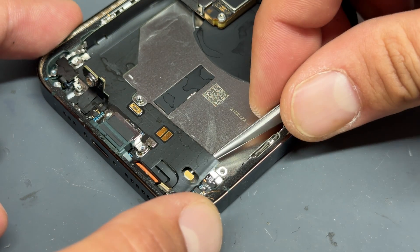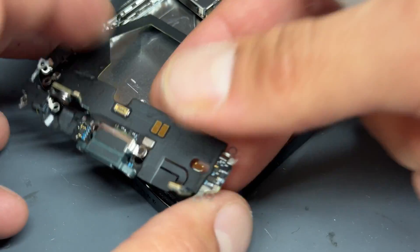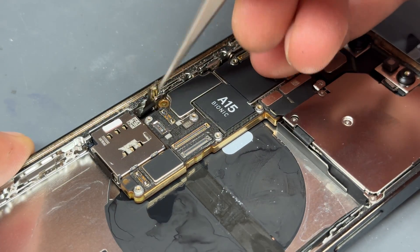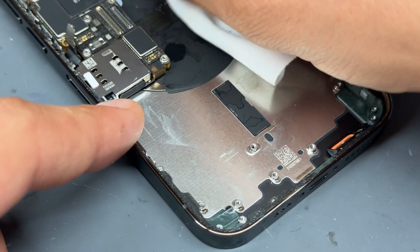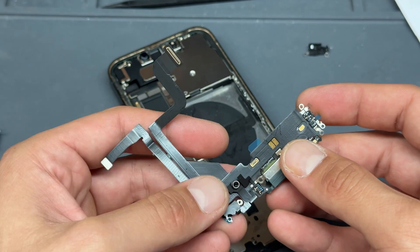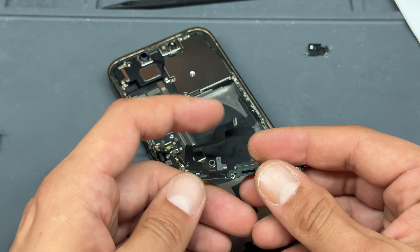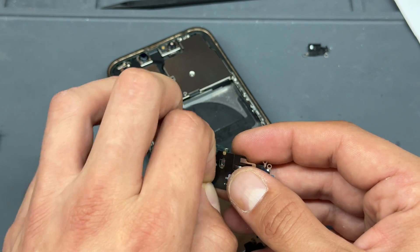Now that the battery is out, get underneath the charging port and lift it up until it comes out. For the top end it's just pulled out — make sure it's disconnected — and then slide it underneath the logic board. That's the reason we take the standoff screw out and the SIM out, so the board can move a little bit and you can get underneath it easily. Mop up any remaining alcohol and make sure it's clean in there. The part we use is an original genuine pulled, sometimes reconditioned, sometimes brand new, but always an original part.